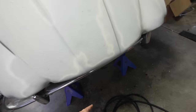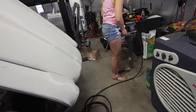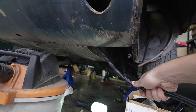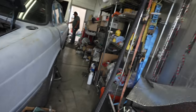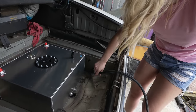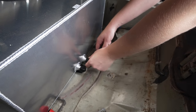Now we're going to put this on the fuel cell on the back and run the hose through there, then bring it up to the front. Getting those laid out nice. Once we get it up here we need to come up to the fuel pump, run it up through there, and then build the final piece up here. Feed it through nice and easy. We're gonna end up having all this hose outside of the car and we'll just have to run it along the inner frame rail. I ordered 20 feet of this line - usually that's enough to get to the front of the car and then some.